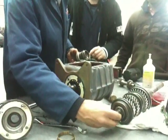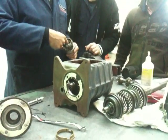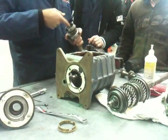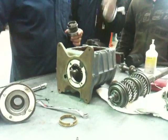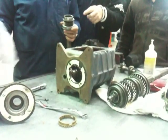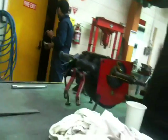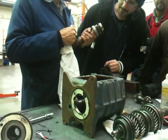This is our output shaft. Have a look at the surface here because that's a bearing surface, and we'll pull all these needle rollers out of here just because we can. This is an input shaft. Up the inside here we've also got a bearing surface as well that we need to look at to make sure that there's no damage.